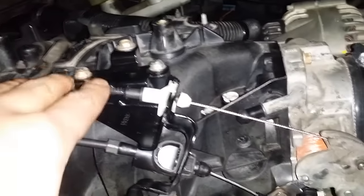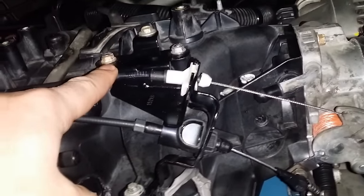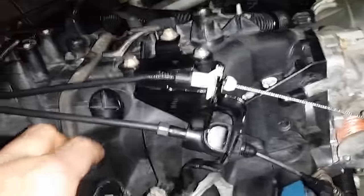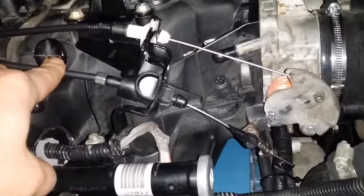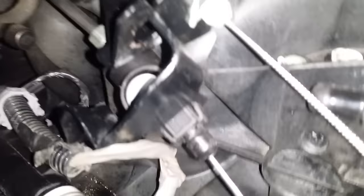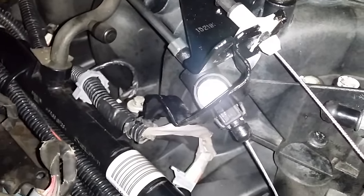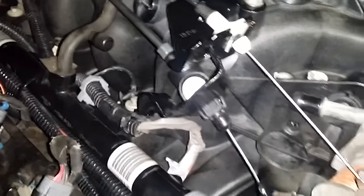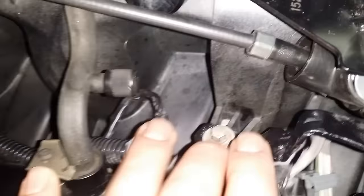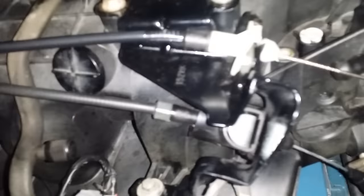I got my angle down pretty good. Truck bracket, Trans-Am style or Camaro style throttle cable, and your standard analog GM overdrive kickdown cable. I made this bracket — covered in a previous video — from a cobbled up TV cable throttle cable bracket from an 87 Caprice 350 Quadrajet. I also made another bracket here to mount it to the support for the fuel rail.